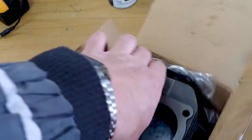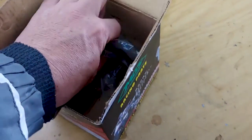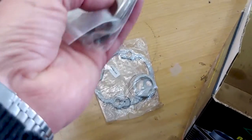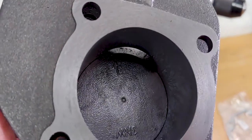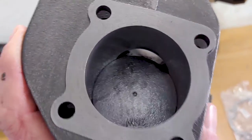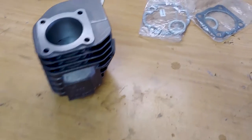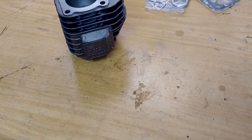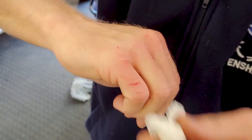All the way from Taiwan — little barrel kits. Don't be scared of Taiwanese parts, because everything Yamaha 4VP, which is the official code, comes from Taiwan. We got a couple of gaskets and a standard exhaust gasket as well — we won't need that because we've got Technigas. I've already pre-fitted the piston with the arrow facing the exhaust port, rings already fitted.